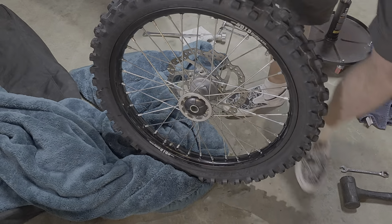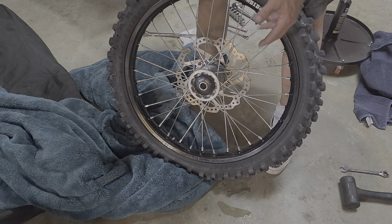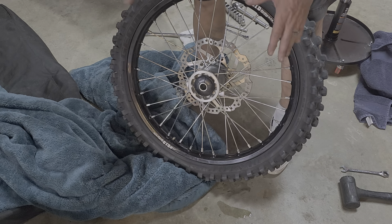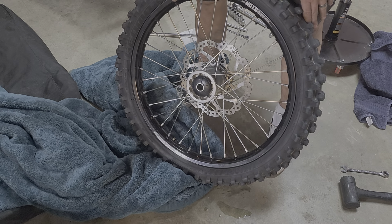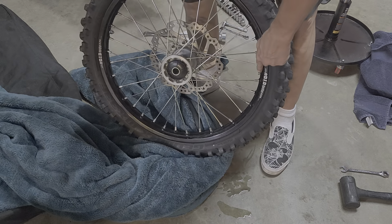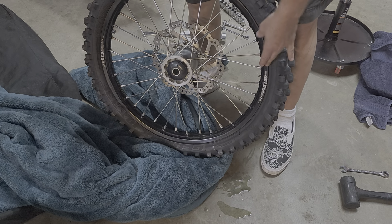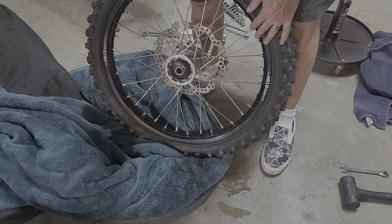If your rim lock is crappy or worn out, doesn't have a lot of grip to it, you might need to replace it, which means you'll probably have to remove the tire at least halfway to get that done. But it's not good to let the stem keep slanting like that, because it'll eventually tear off, and then you'll have a flat, which will be very inconvenient or dangerous.